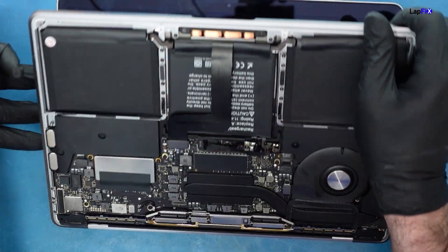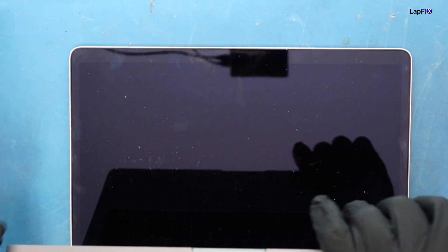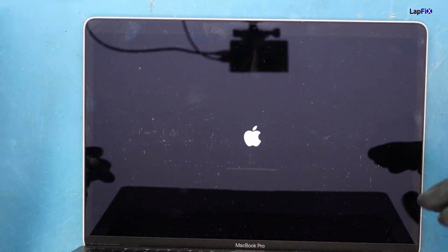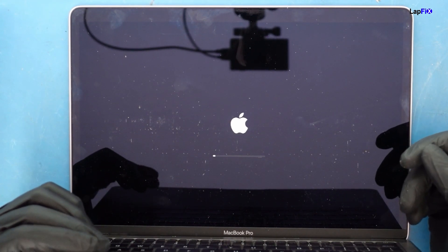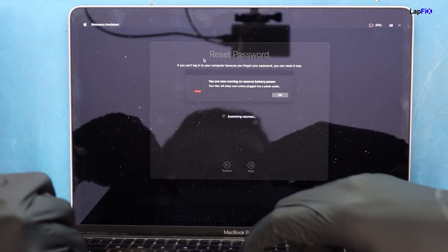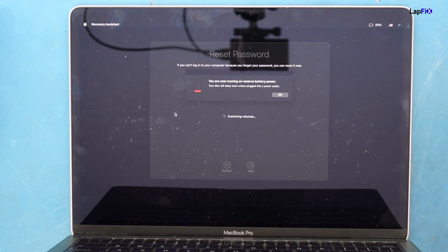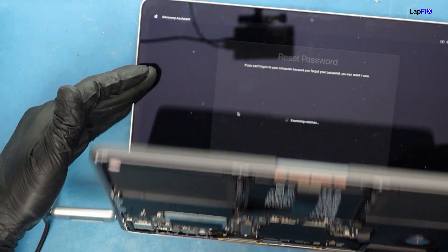I'm not going to put it fully back — let's just connect everything and see if it works. You can tell it's a third-party battery because there's no Apple logo on it and there's a non-Apple brand mark. I can actually feel it turn on now — yeah, it turns on with the battery and charger. The keyboard won't work yet fully, but we are getting keyboard response — the caps light is coming on. There's our Apple logo, there's no loud fast fan. The fan is spinning but not ridiculously loud, and this should load pretty fast. There may be a brief issue on first boot since it may have been force-shut off.